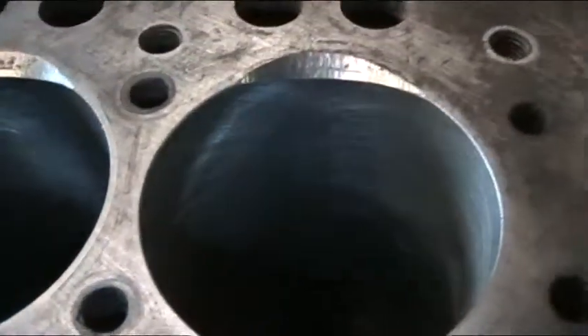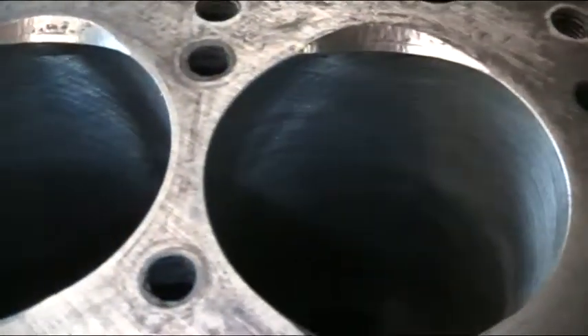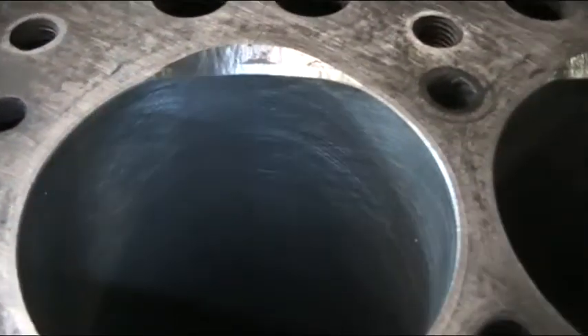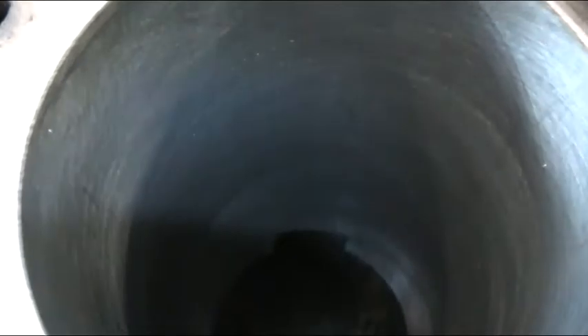There's a lot of work involved in this. The new liners have been bored out to standard to save the pistons, because they are so expensive. They've been honed with the cross-hatch. We found our light on our camera now so we can see the deck — if you can see down the bottom of the cylinder, just down here at the bottom.